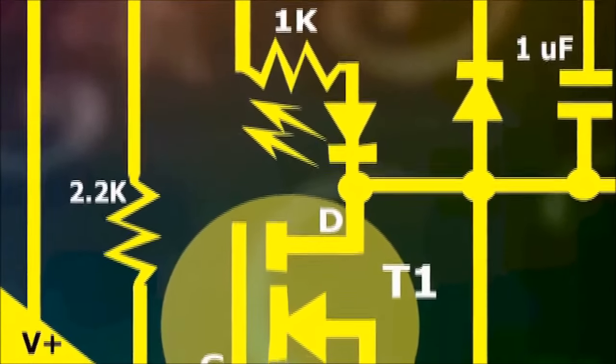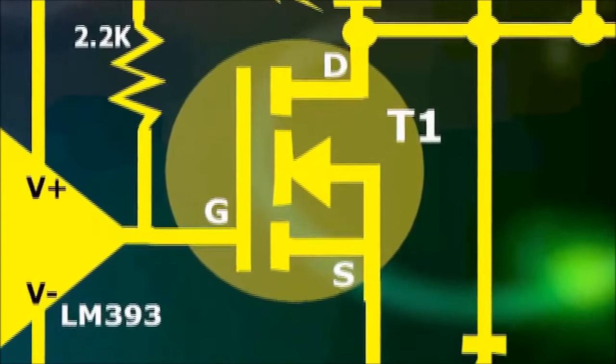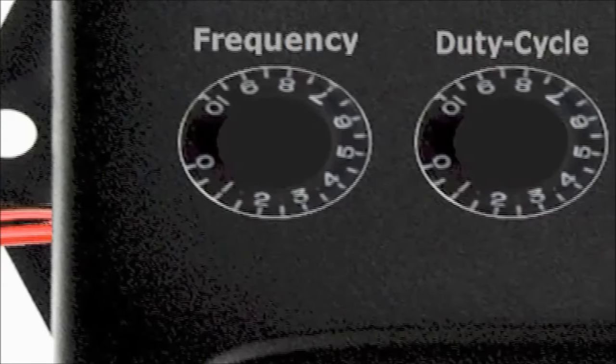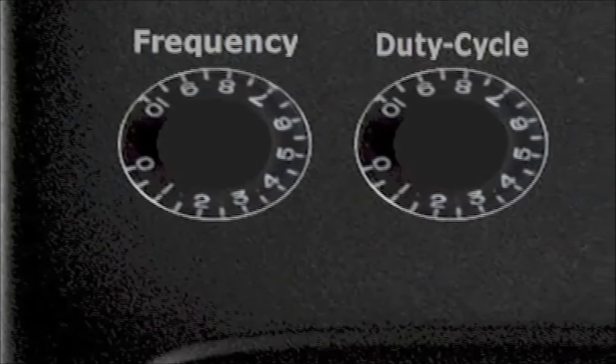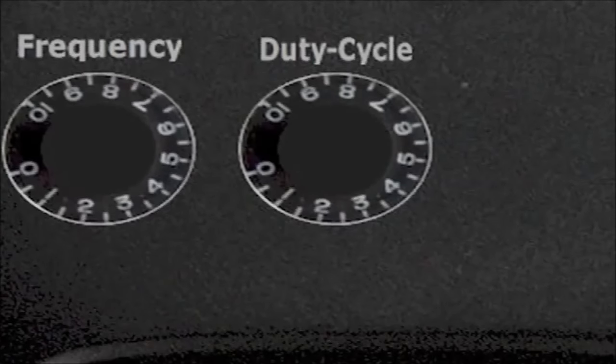The fuel injector pulser is meant to also be used by pulsing the injector for a specific amount of time, collecting the fuel or cleaning fluid, and measuring against a graduated beaker. This is the definitive way to know for sure if the fuel injector is not clogged.